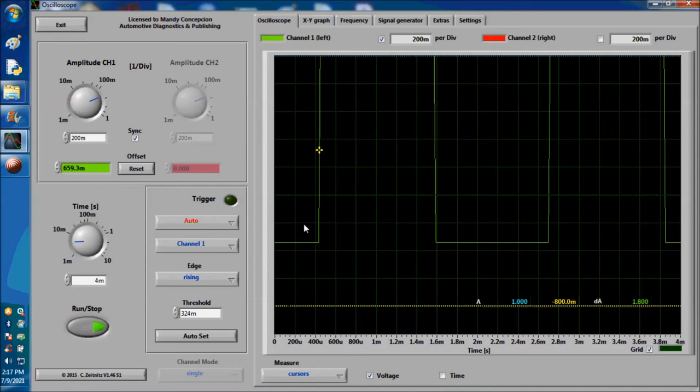And again, you have to do a voltage drop test between battery and the actual ground. I know you're measuring between ground and ground. That tells you right away, if you have voltage between ground and ground, you have an issue. You found your problem already. Then you have to tackle the problem. Either run a new wire or find the issue itself.